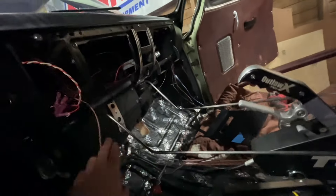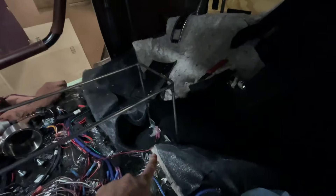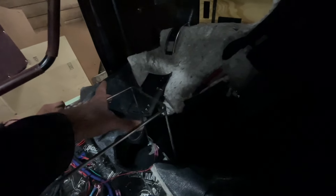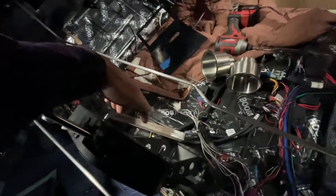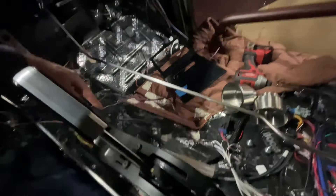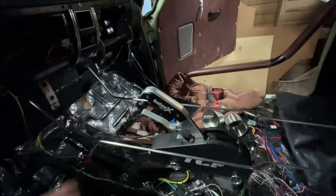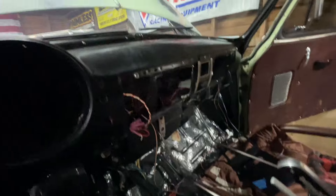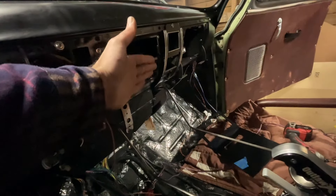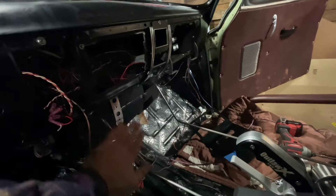This is two separate pieces. It bolts underneath the dash on both sides, then comes down with extension rods to those brackets, all welded together. I made a cut right in the middle for how wide I wanted this after the 90-degree bend. It's a little flimsy right now, but I'm going to fix that — making a bracket off the side of the shifter with a thicker rod coming up into the center, and using more quarter stock to come out and across. The double-din piece can just come straight down with brackets built off there.